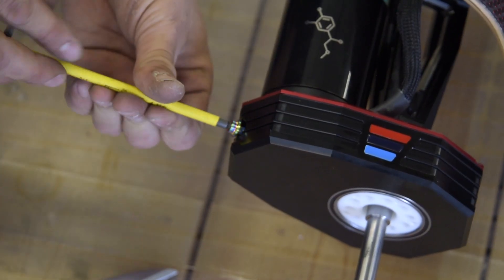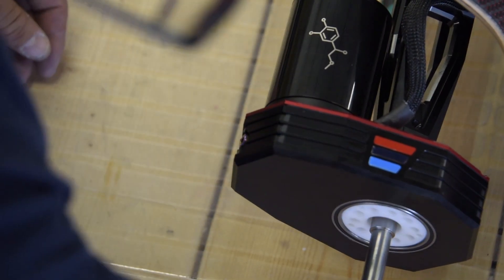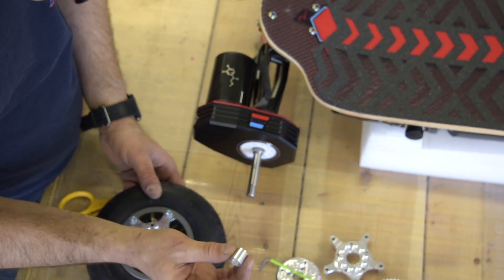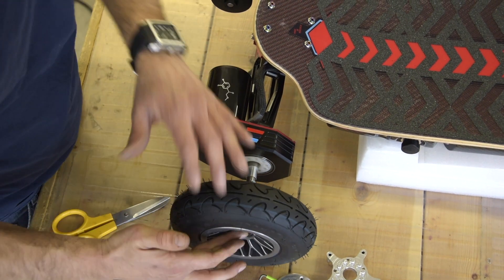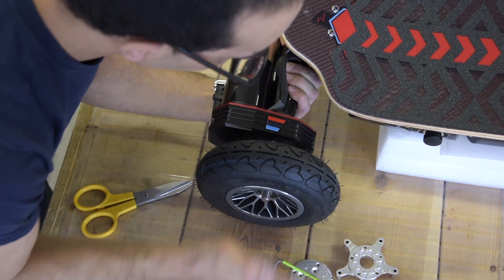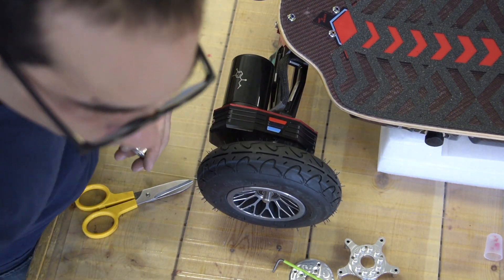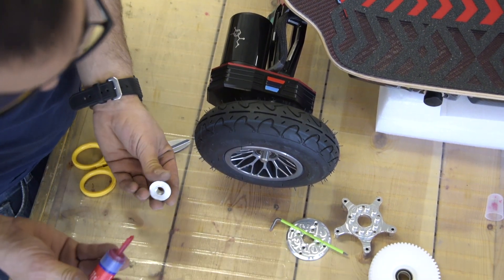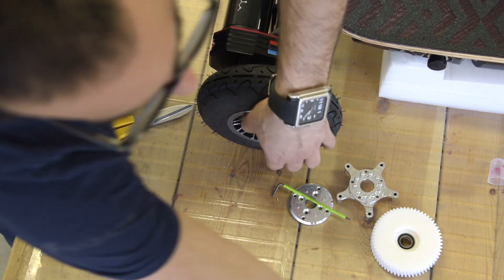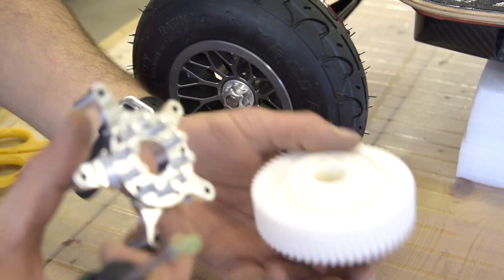This here is the plug for the insertion of the grease. Now we just close it up, make sure no water or dirt gets in there. Next step, put the wheel back on — but first we need to install the little 16.3mm wheel spacer. Make sure all the holes are aligned properly and smash it in. For hyper rims only: if you have regular MBS you don't need to Loctite the nut, but for hyper rims we need to apply just a little Loctite to make sure the nut doesn't pop off. All we're doing right now is pretty much just screwing the adapter onto the truck — simple enough.